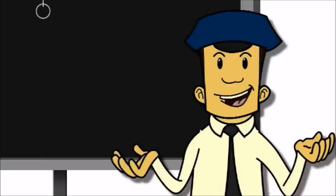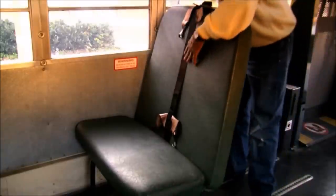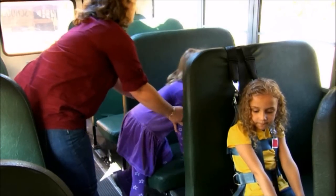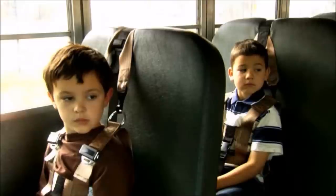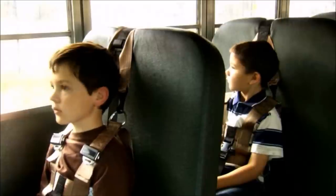What if we drive buses that don't have either seat belts or latch? In that case, we might need to use a cam wrap. Cam wraps come with certain child safety restraint systems, like safety vests. They anchor onto the seat by wrapping around the seat and/or the seat back. Follow the manufacturer's instructions for installing the cam wraps. Make sure the cam wrap is nice and tight — the webbing should make a dent in the seat top. Check to make sure no part of the cam wrap is frayed or torn. The most important thing to remember with cam wraps is that the seat behind the seat with the cam wrap must be kept empty unless that passenger is also appropriately restrained. In a crash, an unrestrained passenger could be thrown against the seat with the cam wrap, possibly causing injury to both passengers.